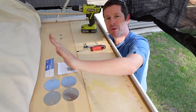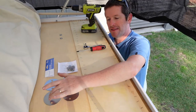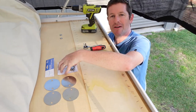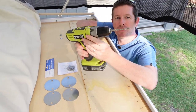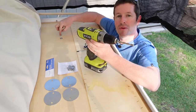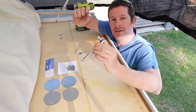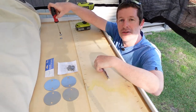If you slide your bed-ends out and push the mattress in slowly, you'll see the plywood floor. The kit comes with four stainless steel discs, the associated hardware, a nice simple diagram, and all you need to install this kit is a drill with a decent sized bit to drill out the two rivets on the top side, a 7mm socket for the nylock nuts from underneath, and a screwdriver from the top.